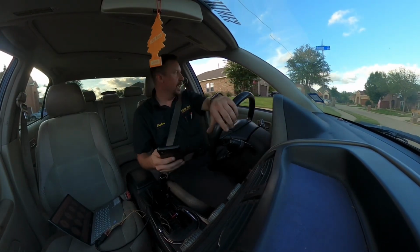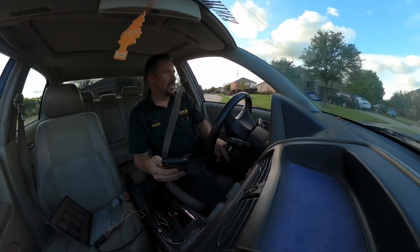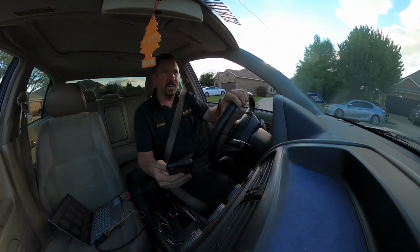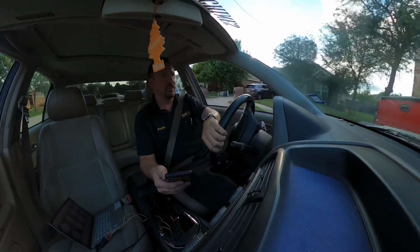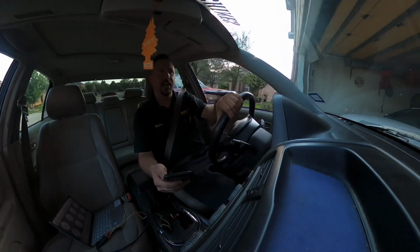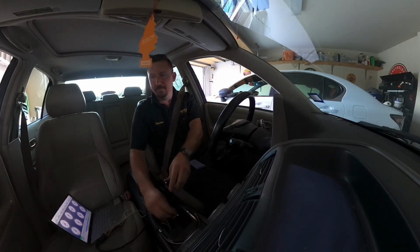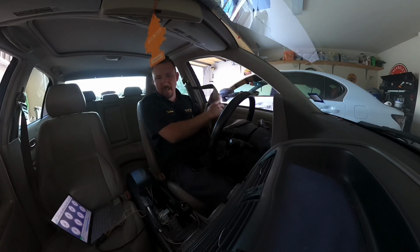So now we can get the AFRs to stay good the whole time the nitrous is on. We may be able to get even more stall out of it. But right now it seems like the nitrous may not be enough alone to spool the turbo up for us to launch off of boost. So I think we're gonna be basically just using nitrous for the first 2 seconds or so before the turbo comes on. But that's fine. It's a pretty small shot, so the bottle should last pretty well.